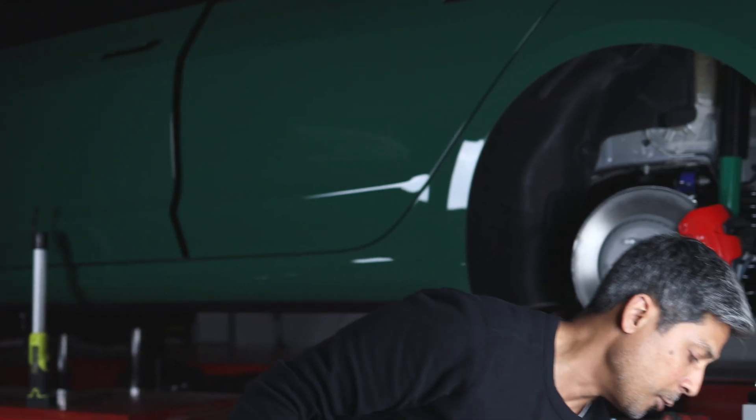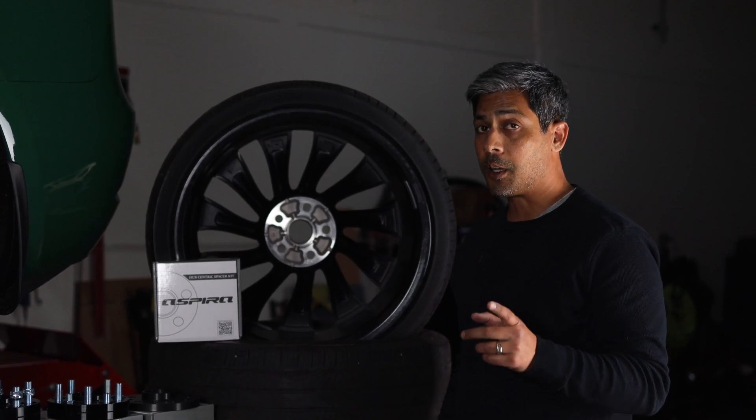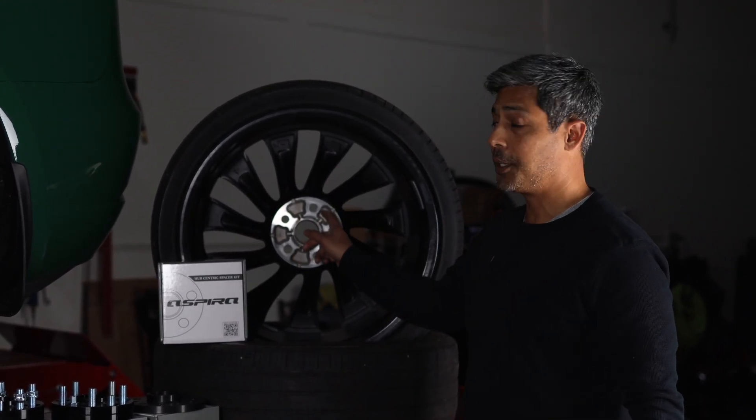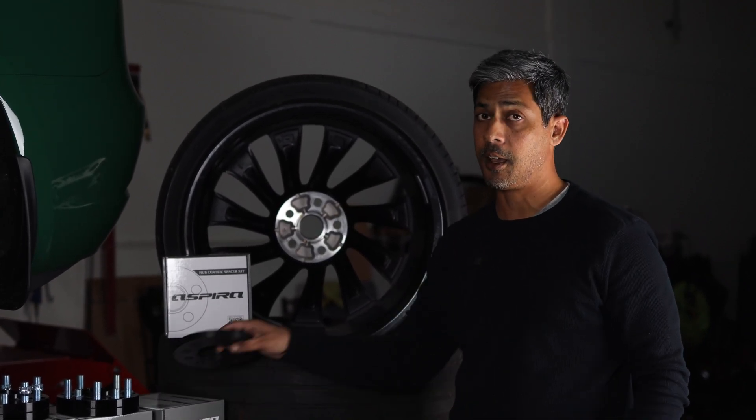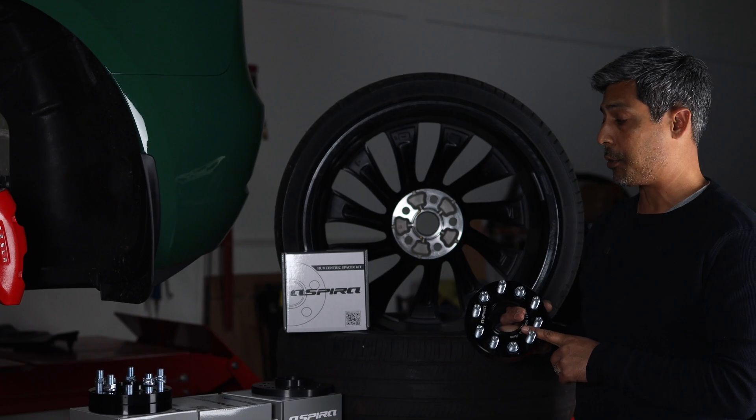We knew about this problem back in 2021. I believe the molds changed permanently around July or August of 2021, but it looks like they still have production happening either from two different molds, different tooling, maybe from the same factory, or from different factories altogether. This car has three wheels in the more favorable mold compatible with the studded spacer, and one which is not. It's strongly recommended that you measure this pocket depth to determine what type of spacer you need — a non-studded H&R type with a proprietary shank lug nut, or the slightly less expensive studded spacer like what Aspira provides.